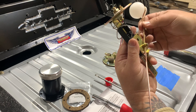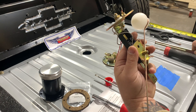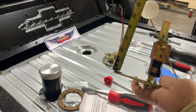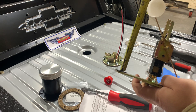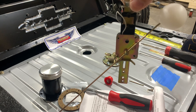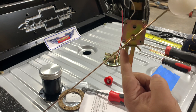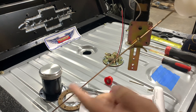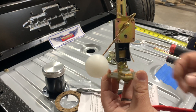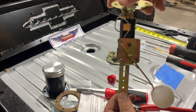To get the exact height that we need, we basically want to measure one-eighth below this flange — so the top of the ball. I think I'm going to use our discarded bracket here, which is about an eighth, give or take. Now, holding this upside down, the float's hanging up top, which is not correct — it's showing that we would be full right now with no buoyancy in midair. So they want you to cut this rod off right at the bottom, which is kind of acting as a counterweight pulling that up. Theoretically, when we cut this rod off, that should fall to the empty position — and yep, we fall right to the empty position. So our sender is now completed.